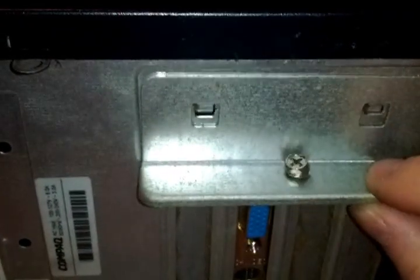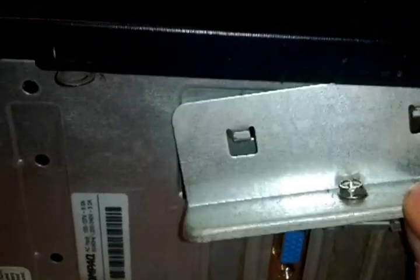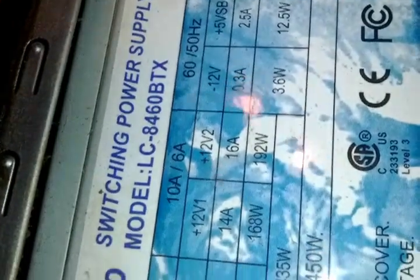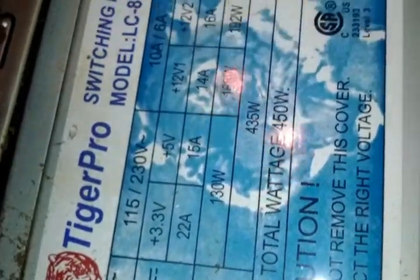There's a bolt here — take a Phillips head and take this bolt out. This is for the graphics card part and accessing the stuff we're going to be talking about. There's one bolt on this model and the compact slides off the hinges.